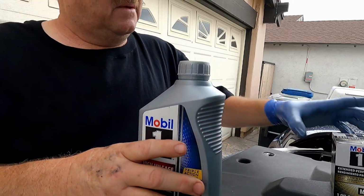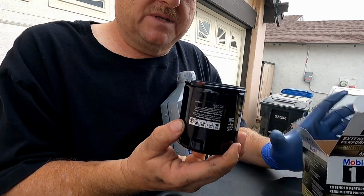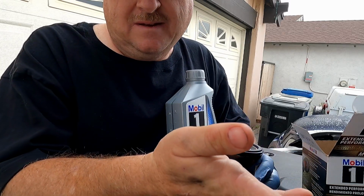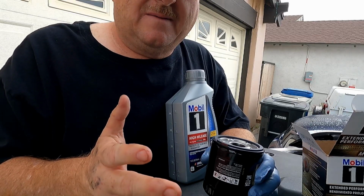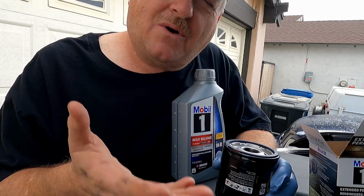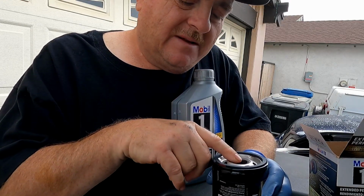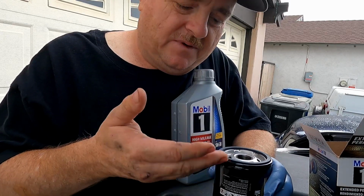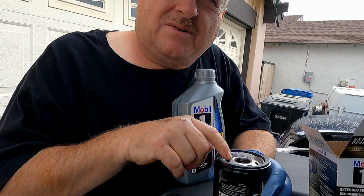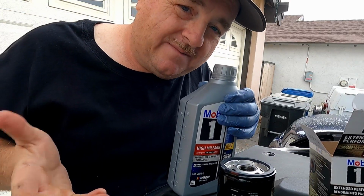But yeah. Now on these oil filters, since the oil filter gets installed in this position, the upward position like this, we can fill the oil filter with a little bit of oil to help minimize the dry start. Now obviously I've had the engine running, so there's oil up in the engine, so that will eliminate all of the dry start really. But if you were to do this on a cold engine, you might wind up with low oil pressure for just a moment while the pump pumps the new oil back through the system. Having a little bit of oil in here already keeps it from having to fill the filter and then pump the oil through. Instead, it goes here and goes right back out again. The filter media in here will absorb a little bit of the oil, also helping to speed up the process. At least that's always what I've been told.